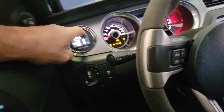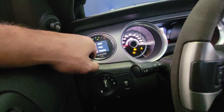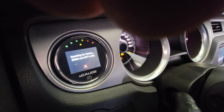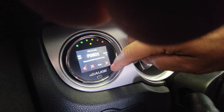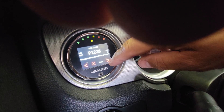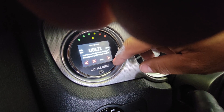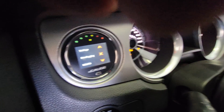Key on - let me check diagnostics, check codes, read codes. There are a bunch of other codes, but as long as there's no throttle codes, I think we're okay. That's the fuel pump not being triggered properly - no trans in this thing, there's a Turbo 400. Waste gate which is a bypass - no big deal, that's all bypassed. I don't have a diff temp sensor either, and it doesn't have ABS. No throttle body codes - we're in the money, guys!